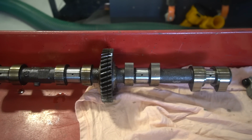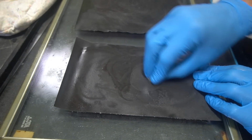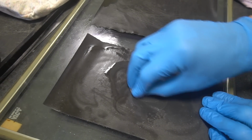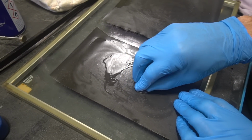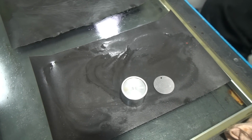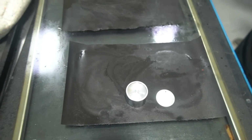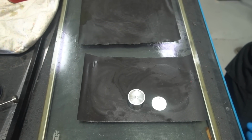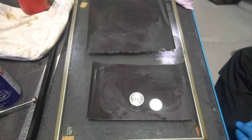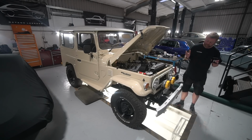So we've just pulled the cams out yesterday and today and taken each shim out in turn. Gibbo's then basically linished it on a piece of glass with, I think, probably 800 grit, or maybe even 1500 grit wet and dry, to give them a finer, more polished finish without taking any substantial amount of material off. Refitted them all, and joy, oh joy, massive relief.